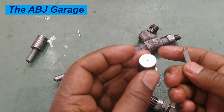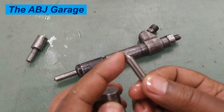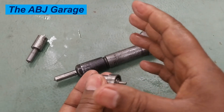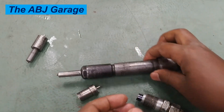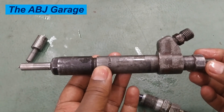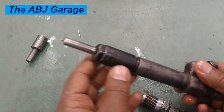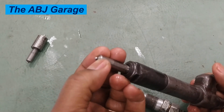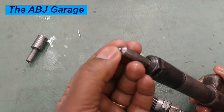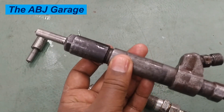As you can see, there is only one passage. Depending on the profile of this needle tip, the fuel spray will be given a definite conical spray pattern. When it comes to a hole type, this is basically used on direct injection diesel engines. High pressure diesel fuel is introduced and then there are tiny holes placed in different directions at the tip of the discharge. So fuel will be sprayed through these holes.